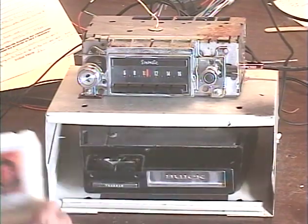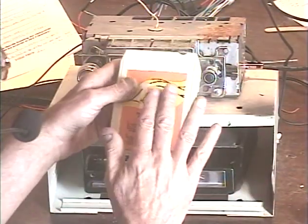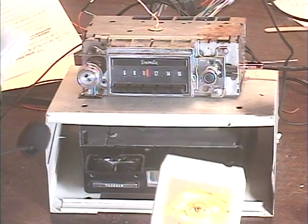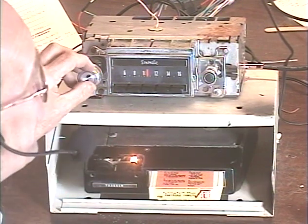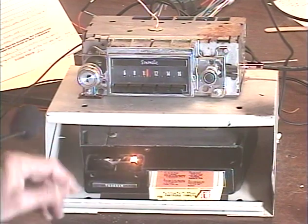There is a need for that additional brightness. This tape sounded too bright, but the next tape I'm going to pop in is older, more worn, and has less treble. We'll see how this tape sounds on the setting I used to make the previous one sound like an 8-Track. Very dull — no life at all. That's why we need the extra treble for tapes like that.